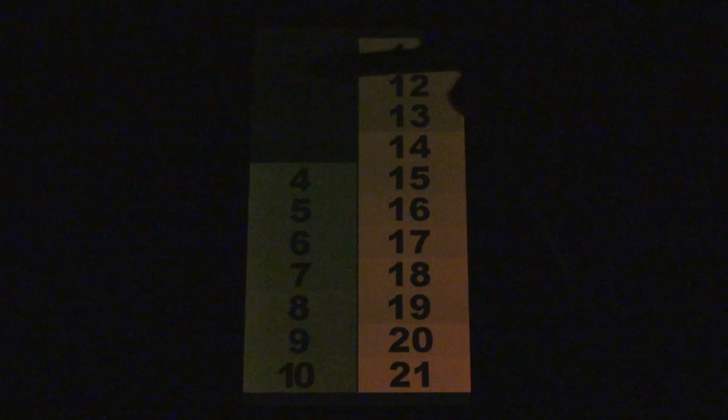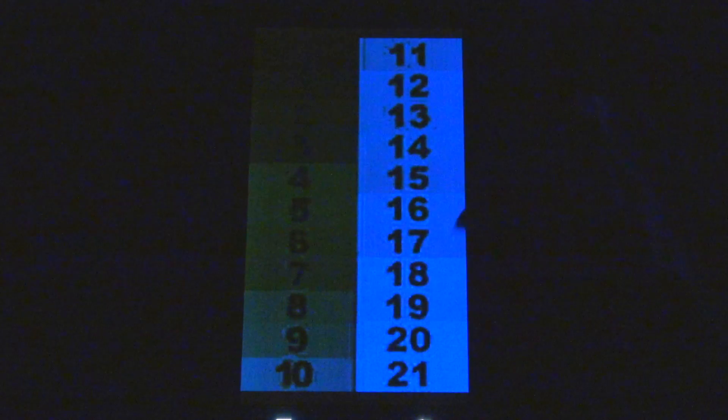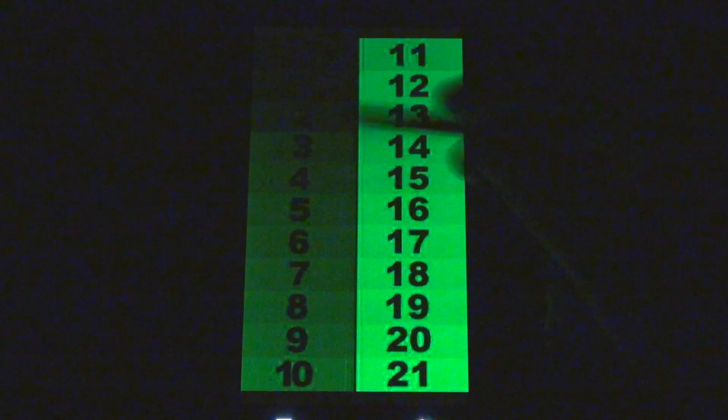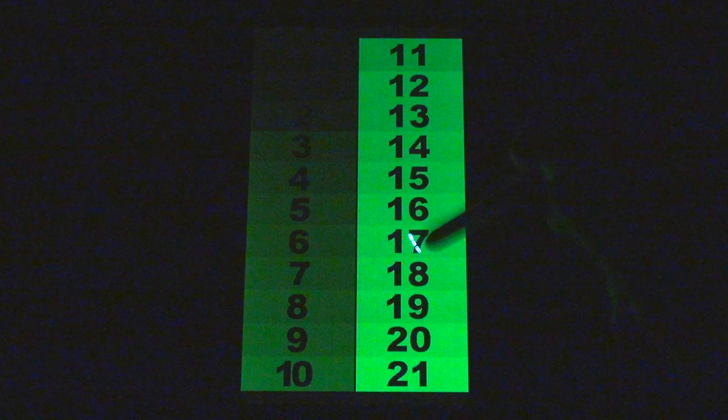At three and two they're very dark, and then it clips at one and zero — so one is not visible at all. Even though the red channel clips a little bit, there is still no black clipping in the overall image because you still have the green and blue channels to compensate. So in a particular shadow where the red clips to black, you'll still have the blue and the green — you just won't see any red combined in that shadow. It's probably good to note that if you get a red-channel-only shadow in the dark gradient, it will clip black. I've seen this same behavior in two Galaxy Note 2s.